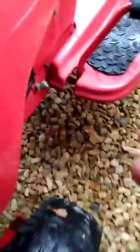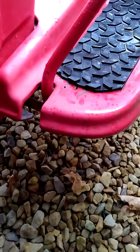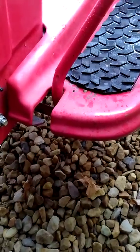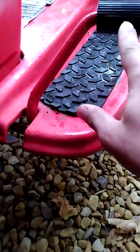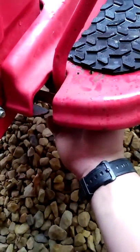If you come over to this clutch arm here, and it's all the way in 7th. You want to do this in 7th gear. See all that back and forth movement? That's an issue, and that might explain why I have to push this thing down even further when I try to start it in order to depress the safety switch right here.